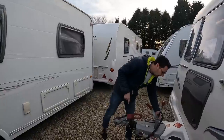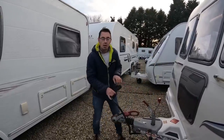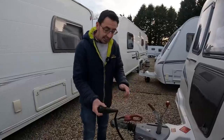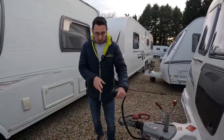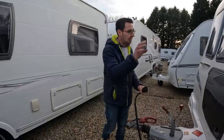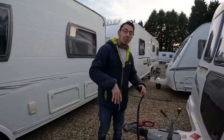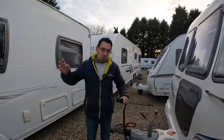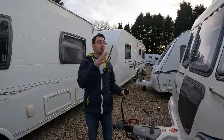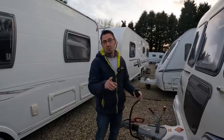The other thing to do now is check your towing electrics. The caravan has just been sat there if you haven't been using it, and things just mysteriously go wrong. So let's back the car up, connect it to the caravan, and check all of our lights — indicators, running lights, fog light, reversing light. It gives you a chance to check everything through before you're close to actually using the caravan and find issues.